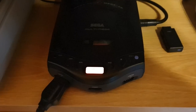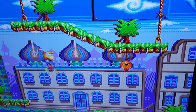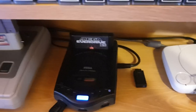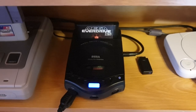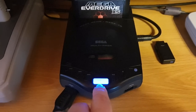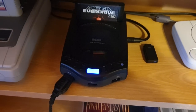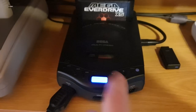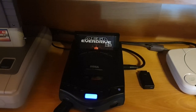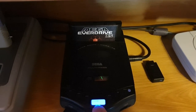Orange is the stock color of the system. If you want to switch with the front button, hold it until it changes, release, and away you go — that's back on 60Hz. That's another thing Simon added: a remote function. So if you're sitting on the couch and want to play a game in PAL or Japanese region, you can press the buttons on the controller, switch the region, and the LED color will indicate what it's gone to. For Mega CD, you want it in the correct region for what you're playing — if you put a USA game in I think you need to be in that region on the system.